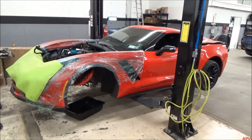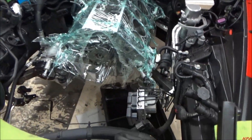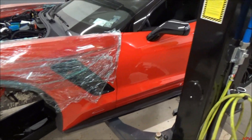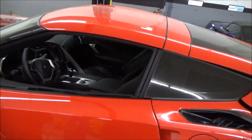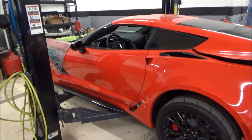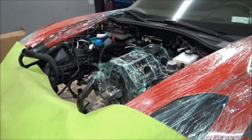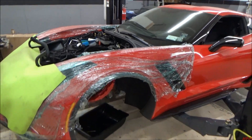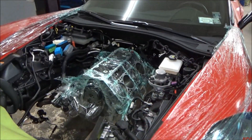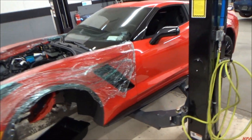Here's a C7Z that's in for quite a bit of work. We are putting a camshaft in it now. Got everything torn down, no front subframe. There's the subframe and all out the front. Automatic car. We'll be taking this car right to the track as soon as it's finished up. We're waiting for the heads to come back from porting. We are porting the factory blower in-house, blower pulley, match kit. It's getting a decent build going on and should go well into the 900s. We'll see how deep we get with it.